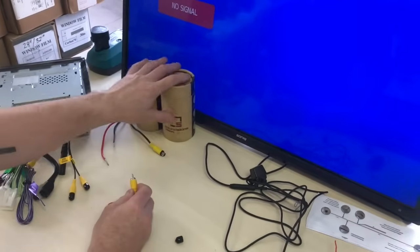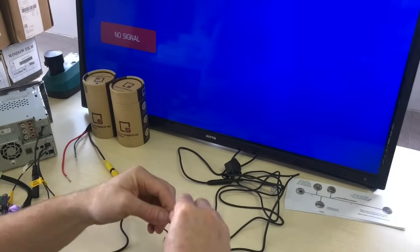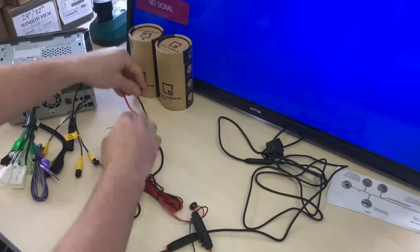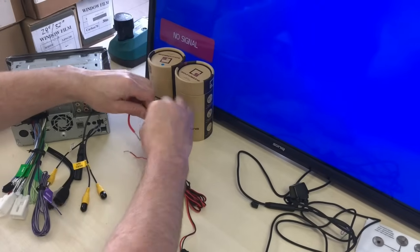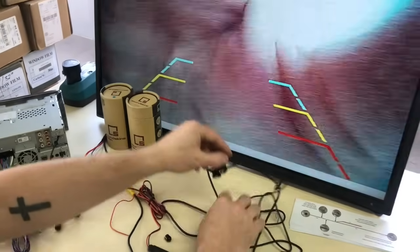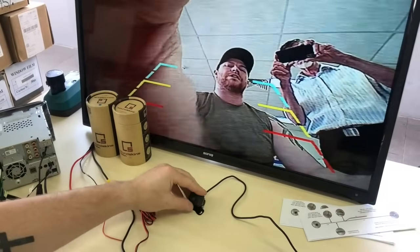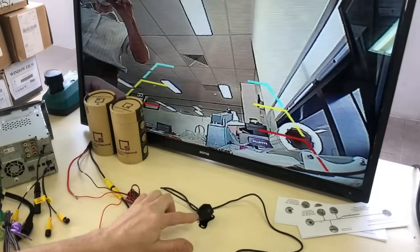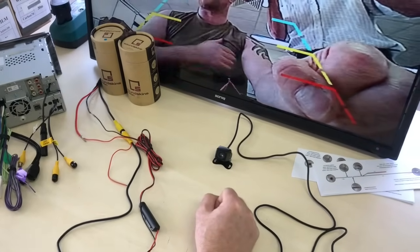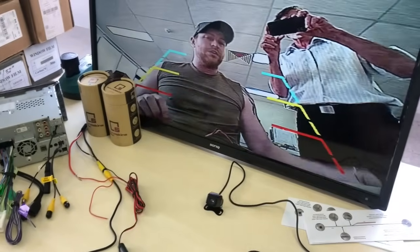Let's give you a quick example. We'll take this screen as our stereo — we've got the camera plugged in, and we're going to take this power and earth and pretend these are our reverse lights. So plugging this in — pretend this is your reverse lights hooked up to earth and the reverse light — and this will power up your camera. There we go, the camera is actually working. This image looks a little grainy because of how large it's being displayed, but this is a high-resolution 720 by 480p camera, which will give a really clear picture on any seven-inch or six-inch stereo screen. It has really good night vision as well.